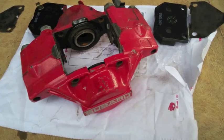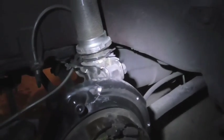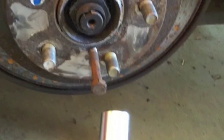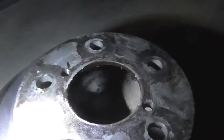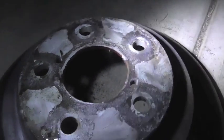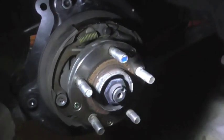So I'm going to pop this on the rear of the car. First you remove the old rotor by making sure the handbrake is off, and then if it's a little stuck and stubborn you can get a bolt and feed it into these little holes. That should tend to do the trick to help release the stuck rotor from the hub, and then obviously check the condition of the hub. If it's quite clean and flat like the case here, I wouldn't worry about cleaning it.